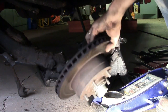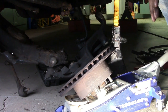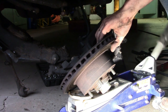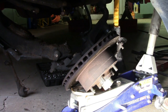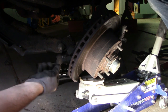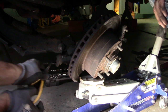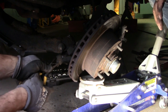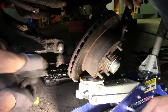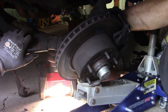We're trying not to take the brake line off and have to bleed the brakes, so we're going to set a jack under that caliper to keep the tension off. Now we just have to take loose the other ball joint, which looks pretty crusty. But we know they had it off when they put the disc on. Right now I don't see a cotter pin — it looks like a very loose ball joint.